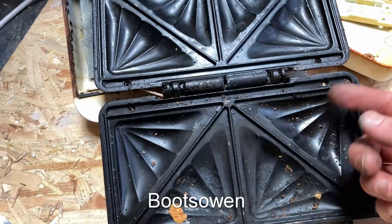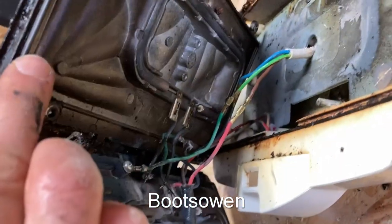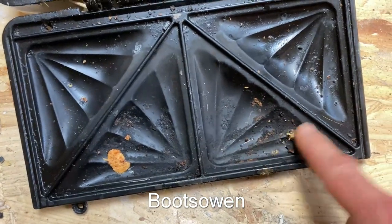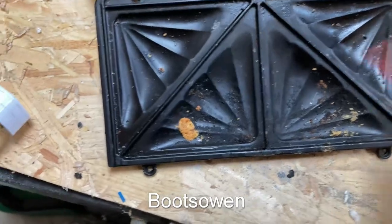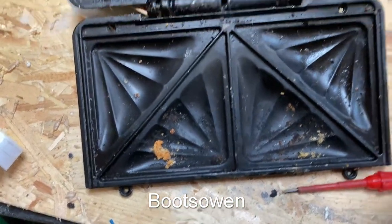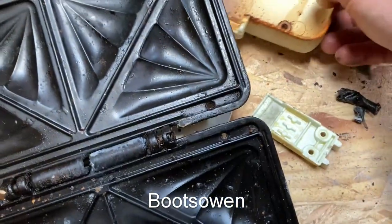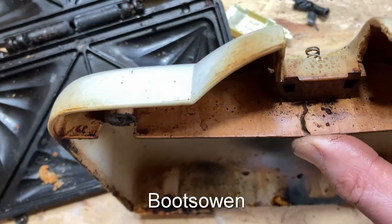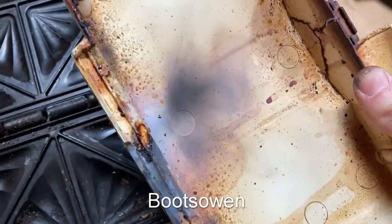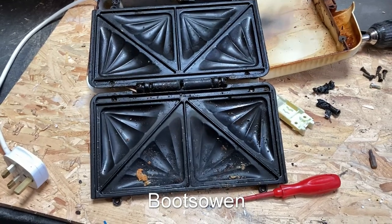What I could do is reverse the elements, top for bottom. Actually no — the thermal fuse is on one of them, though they are reversible. This side gets the cheese residue — there's a bit of carbon, a bit of cheese. The plastic here over time has gone brittle and cracked. It's not the end of the world; I think I need to root through my supplies — I might have some of that cable hidden somewhere.